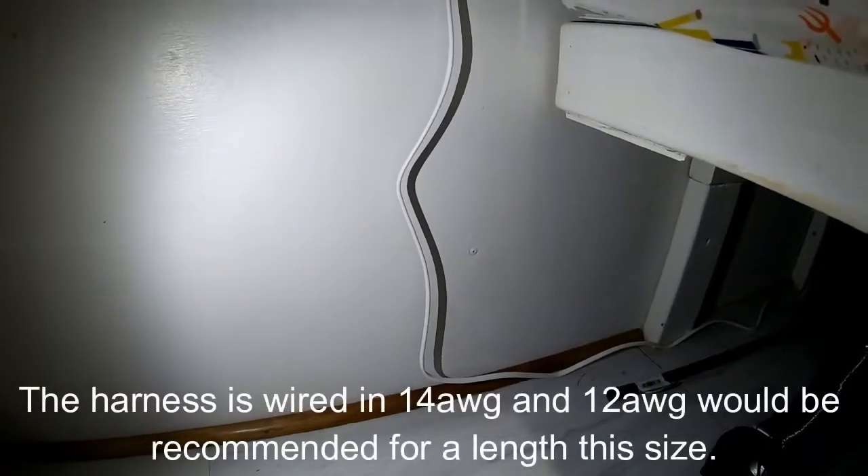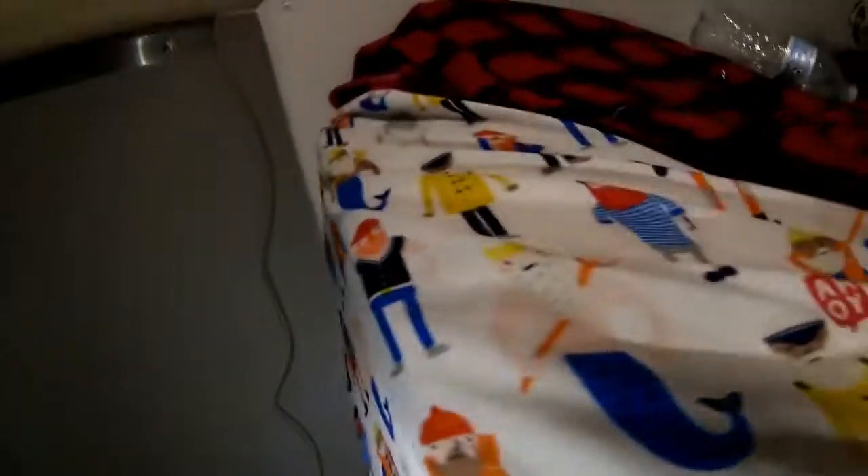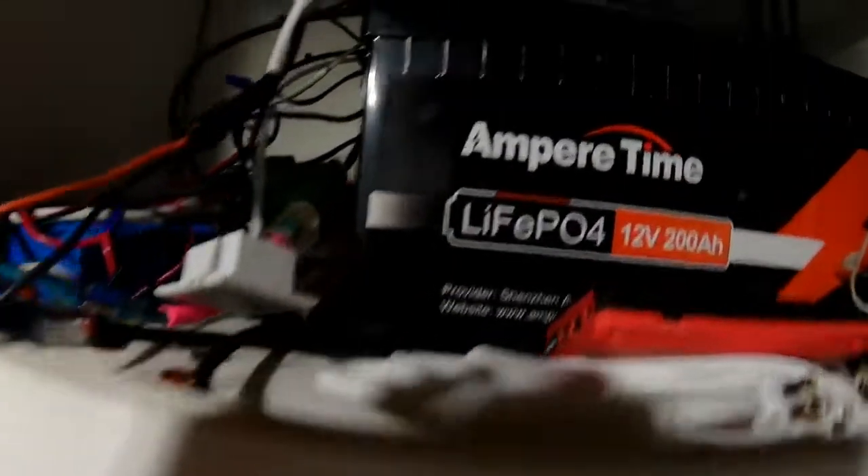This is one area that might be ill-advised by folks in the diesel heater community, but what I did is simply use a 16-gauge two-strand wire — basically a 12-foot extension cord — running from that harness up to our battery, hooked with alligator clips. The reason I used alligator clips is I don't want it permanently installed. This unit runs maybe three to six months out of the year, and I don't want permanent wiring or a large fuel tank mounted outside for the other half of the year. I can simply alligator clip it in place and then unhook the harness once we don't need the heater anymore.